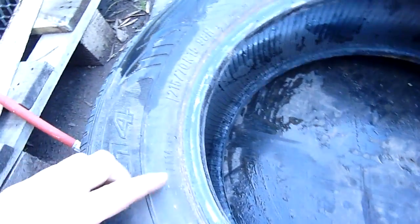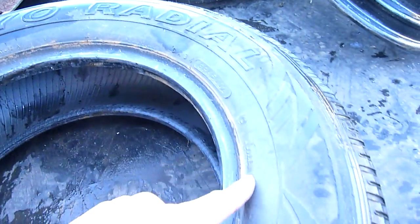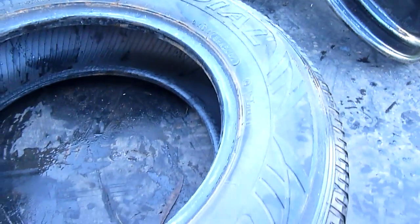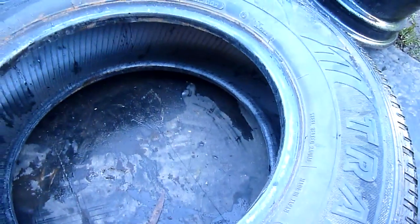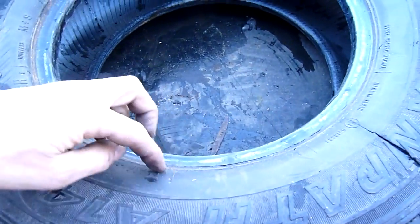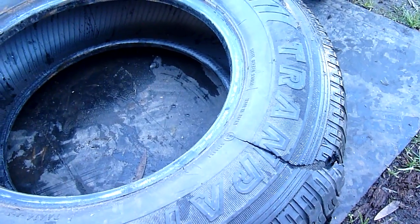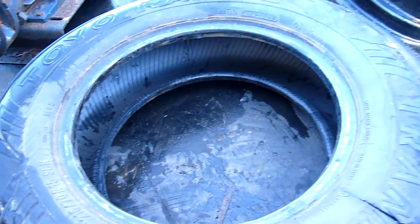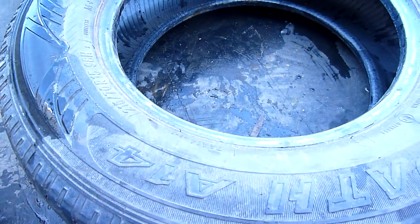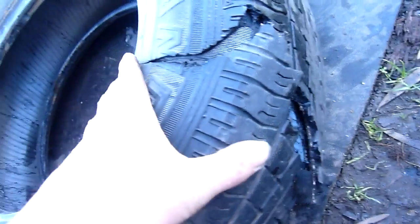The codes on this show the size, A-rate temperature, and various codes, but nothing that really tells me the ply count. It doesn't even tell you how many plies there are. Normally there's a molding on there which tells you how many sidewall plies, how many tread plies, and what material they're made of, but it's not on this one - I'd have to look up the data sheet. Either way, Toyo Trampath A14 - failure at 250 psi and only in a spot where it had been punctured.